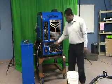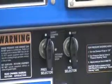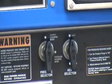One of the things you'll need to ensure is that you do both circuits. Make sure your heat selector is set to hot. This allows the coolant to go through all the heat exchangers. If it's set to warm or the middle setting, it will only go through one or the other of the heat exchangers. Setting it to hot goes through all the heat exchangers.